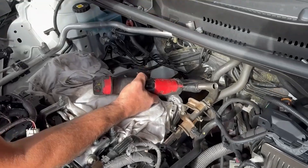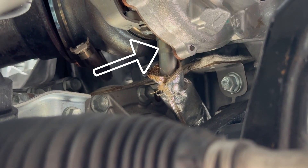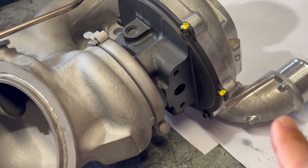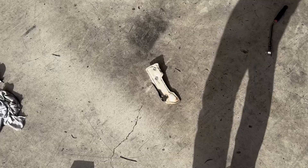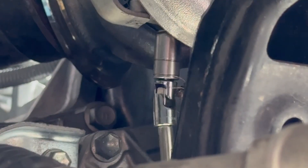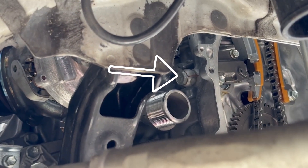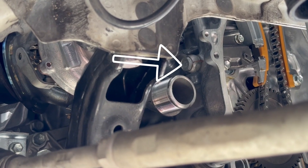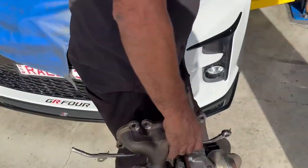So this is what we're taking off currently. The exhaust manifold closest to the v-clamp has got a spacer on it. That's the oil return to the sump off the turbo, the exhaust side. Taking off the two bolts on the outside because of the shield around it - there's the little heat shield. So that there is the oil feed; it comes in from the side of the engine, just behind the tensioner. Same oil gallery that feeds the oil tensioner also feeds the turbocharger.